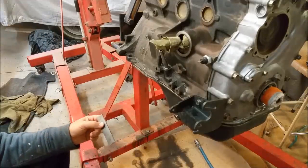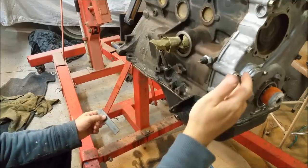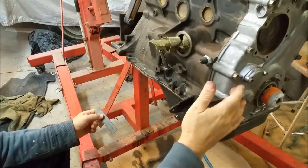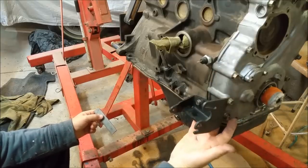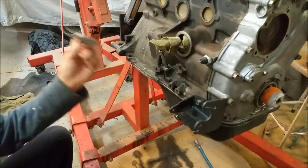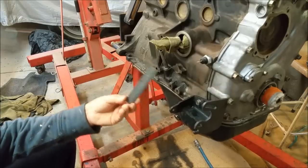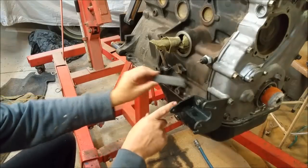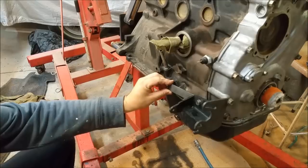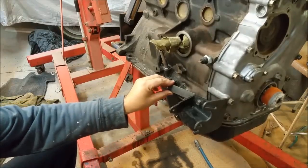Still doing a little bit of cleaning. I've got this power steering bracket on. I'm wondering if the original timing case is the thing that should have had the embossed part there for the other bolt. We can use a bit of flat bar. It's going to have to be bigger than that, and I'll make it a bit thicker as well. And I can have it up on an angle, maybe notch it a bit for there's a casting there, you probably can't see it from where you are, just so I can cover these 2 8mm bosses.